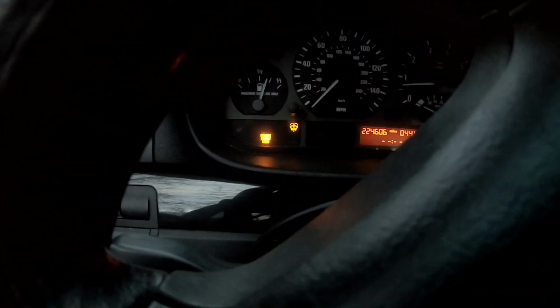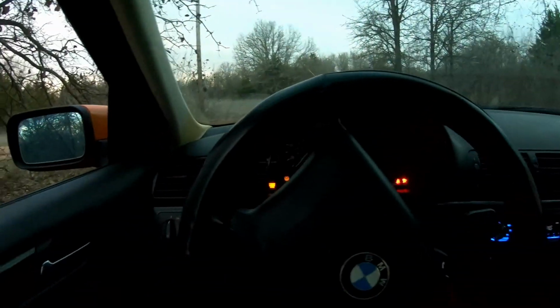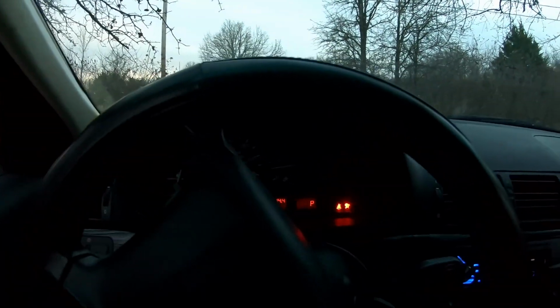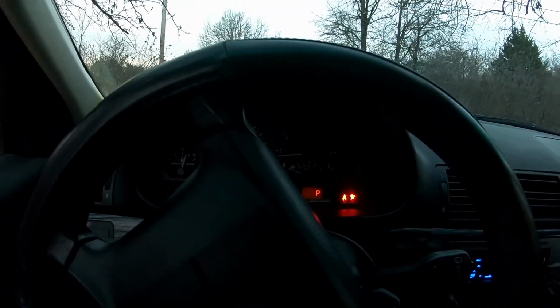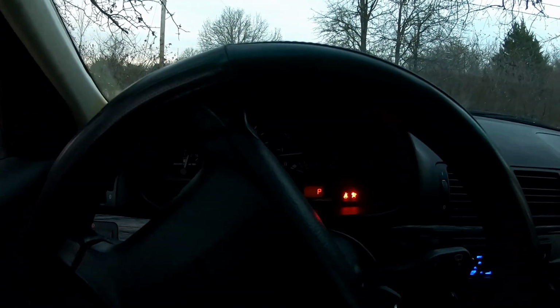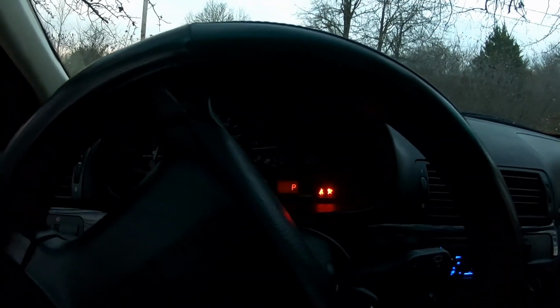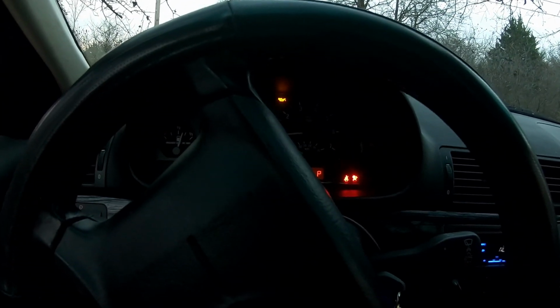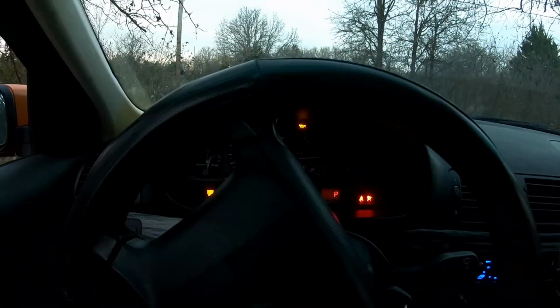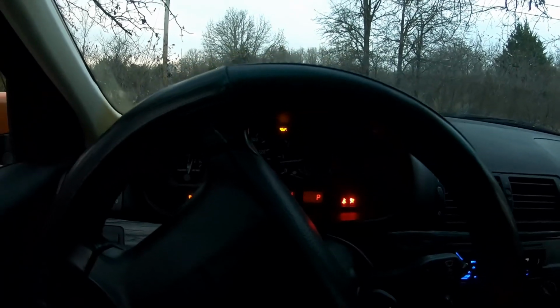And you see we still got the engine light. And it does not go into limp mode no more. So we did fix that also. The one thing that was wrong with this thing was, I think it's like the intake. Yeah, there was only one bolt holding it in, and it was just finger tight. Now it's legit half of this car. Everything was just finger tight. So we're thinking the kid just went through and kind of just half-assed everything and threw it together to go through an auction. So here we are.